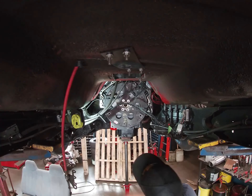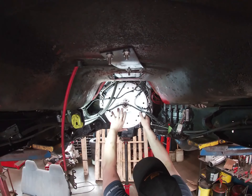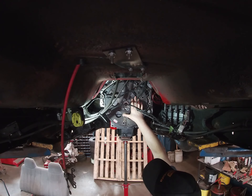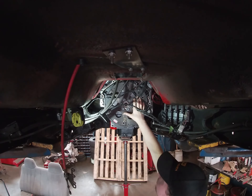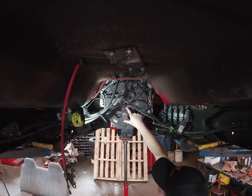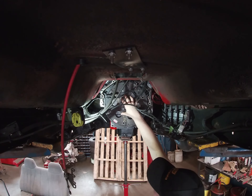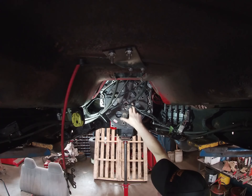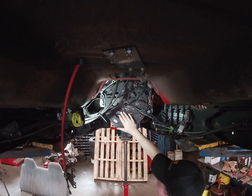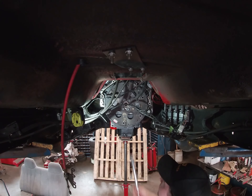Now we're on to the flex plate. Turns out I gotta put the old flex plate back on because my ARP bolts are too long — they're meant for a straight flex plate with a spacer, and I got a dish flex plate. So I'm better off running the older flex plate with the better bolts, because that's probably what's going to fail first. Leave the SFI plate for later — unfortunately I'll have to pull the transmission out again later and do it, but whatever. Torquing them up to 85 foot-pounds and starting to put this tranny in.